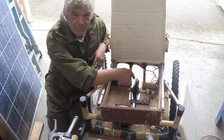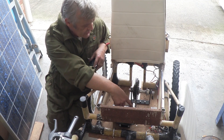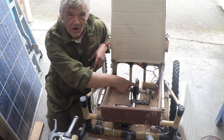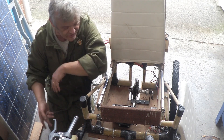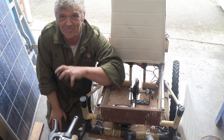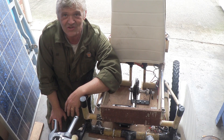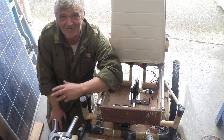So what we've done is we've put a gear chain in here as a cassette from a bike. The motor goes to the big cog on the cassette, and the little cog on the cassette goes to the chain drive, so effectively we're getting somewhere between six and eight to one. That makes a big difference on how this thing is going to perform — doesn't draw as many amps, doesn't get hot, and takes off, which is really cool.